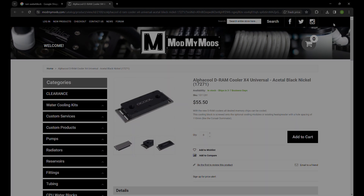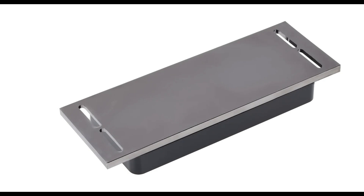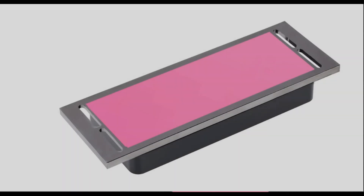Having the mounting tabs on the side of the water block helps for two big reasons. Firstly, it makes sure that there's good mounting pressure between the water block and the heatsink — mounting pressure plays a big role in how much heat is able to dissipate because it gets the component closer to the heatsink. On top of that, because I'm able to cut the bottom case cover to use those tabs to press it in, it eliminates the need for any kind of adhesive, which would make this difficult to service later on where you'd possibly have to deal with disassembling a water block with some residual liquid left in it. This way it's able to come off as one unit because you're only using thermal putty as a thermal interface material.